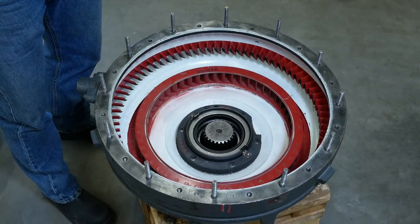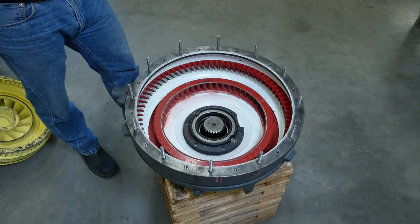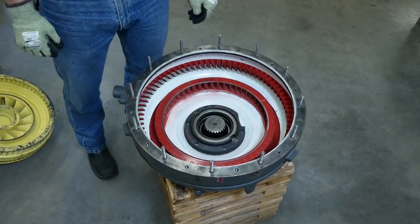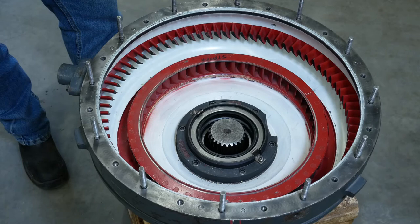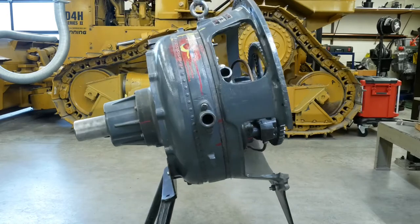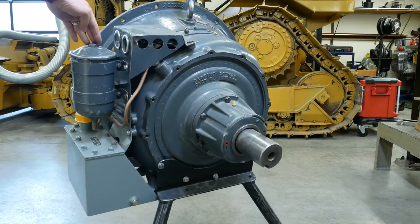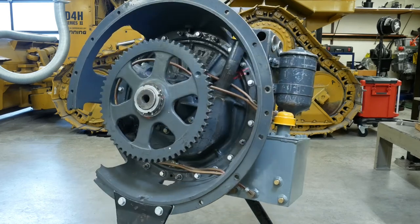The oil actually hits the turbine three times, making this a three-stage converter. All multi-stage converters have fixed stators, so they perform the converter phase really well, but they don't do the coupling phase or rotary flow very well. This particular multi-stage converter also does not have a lock-up feature. Where most torque converters run a ratio of around 1.75 to 2.1 for on-road applications, and up to close to 3 for off-road applications, this converter actually achieves a 5-to-1 ratio.